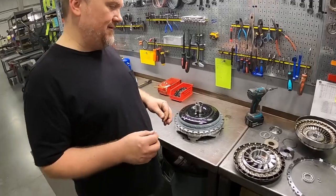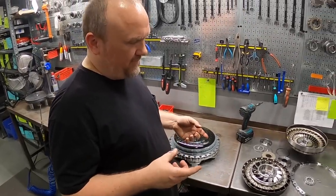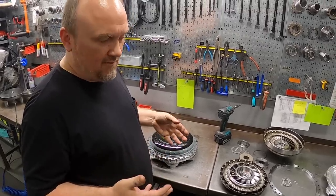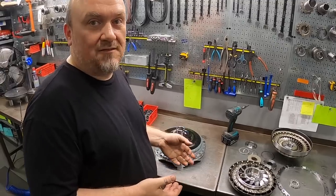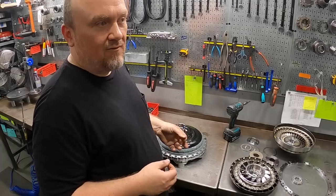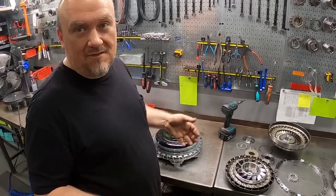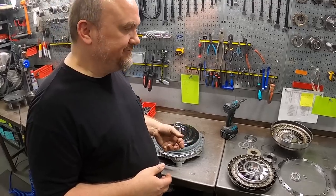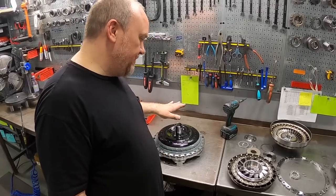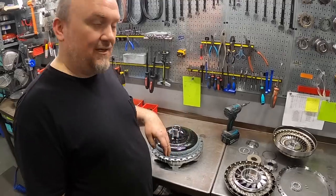When we're dealing in micro fractions of an inch or a millimeter, those differences are negligible enough that it's not going to give you any measurable change in stall characteristics. We're talking large movements of clearance, typically starting around 1 millimeter, 40 thousandths American, 50 thousandths, is where you're going to start seeing actual stall characteristic differences. That's a fair bit of material in engineering and machining. It's a huge amount. That's a lot of material, yeah.